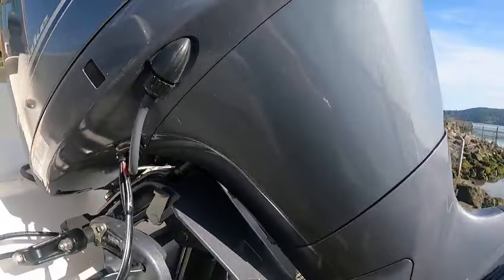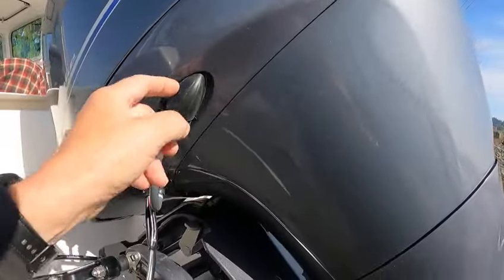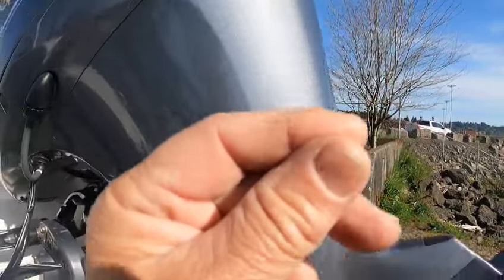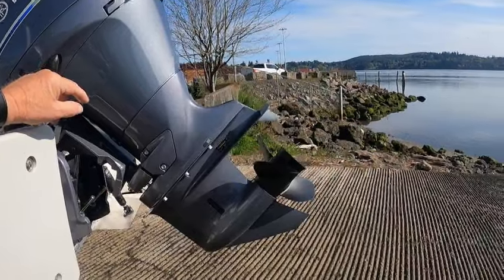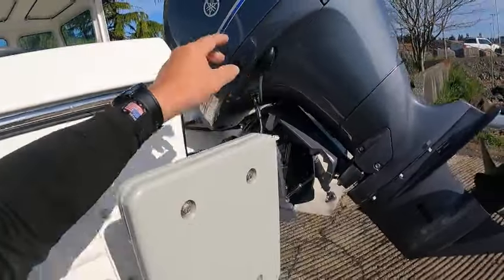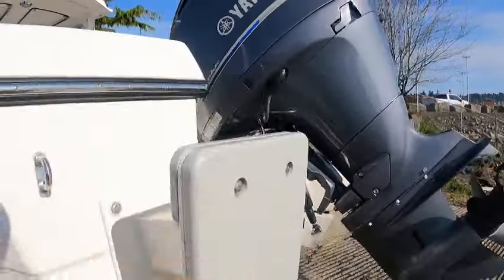Fresh water flush — touch your motor. If your motor is warm, when you put water here — this is the backstop, undo this, put your garden hose on the end. When water comes out the P-tube lukewarm, that means it's doing its job. If that water comes out cold, it ain't going to do any good — the motor's got to be warm to clean everything out from top to bottom. Do not start the motor if you use this one only.